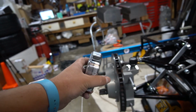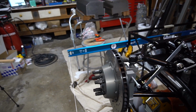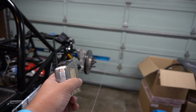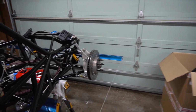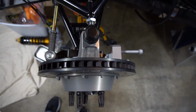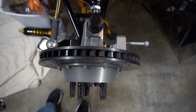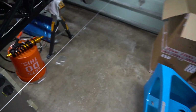For camber, which is this way, we'll probably start at -2 degrees camber for the front, and then for the rear, again angled with the top into the car, we'll start at 1.5 degrees negative camber. And then finally, if you look down on the wheel, our toe, which is like this, we're going to do just a hair of toe out on the front, maybe 0.5 millimeter or 1 millimeter toe out in the front. And in the rear,